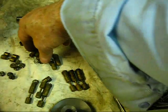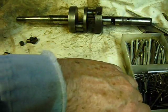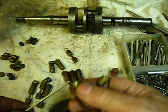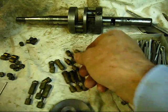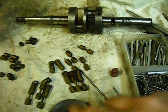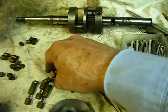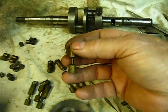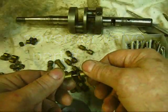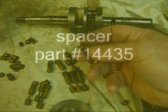The governor is what I'm talking about right now. In this show-and-tell selection, you can see how that spring is all askew on that one — and that one too. It's completely ruined. This part right here by itself is part number 14433, that's the governor valve. And this collar right here is 14435.